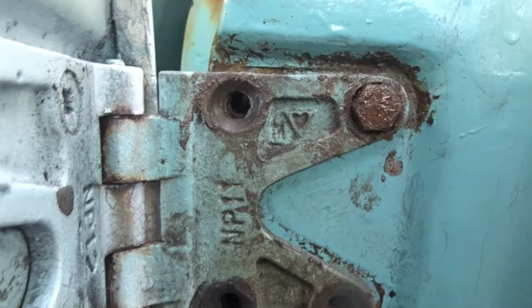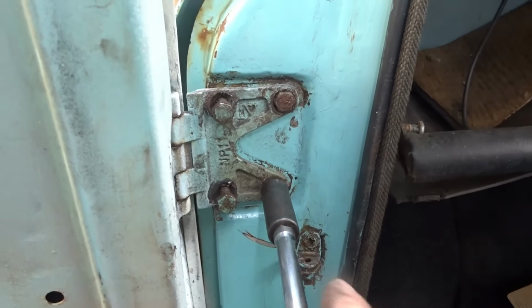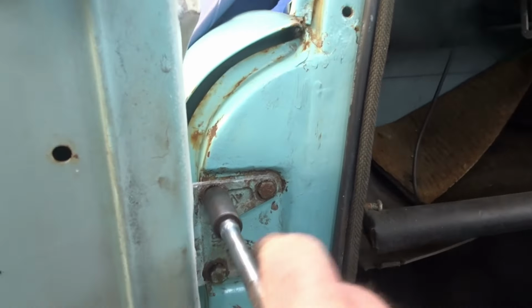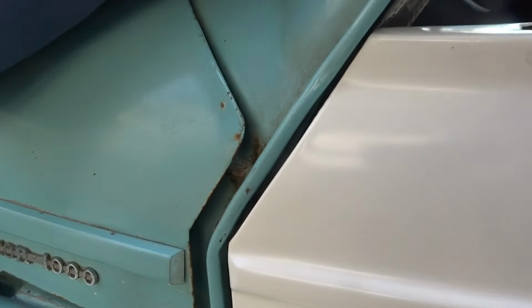A few moments later, all the bolt holes are all lined up. Door bolted on. I'll show the gaps that I've got. So you remember the gap down the side that meets the A post? Yeah, they're quite tight up against there. It's not a lot of movement to go further forward. Well, I agree. I think it's not a bad gap. That's all the way down. However, it is a little bit in, but I'm fully out on the hinge and a little bit out here.